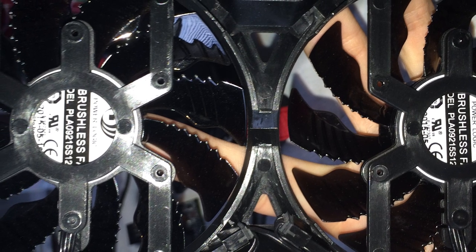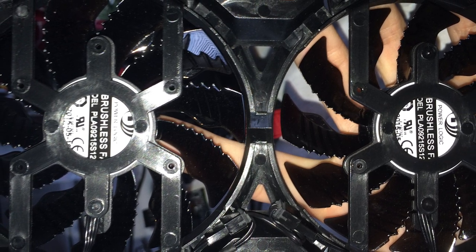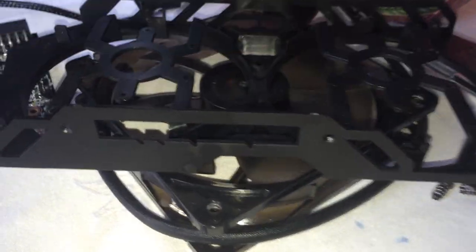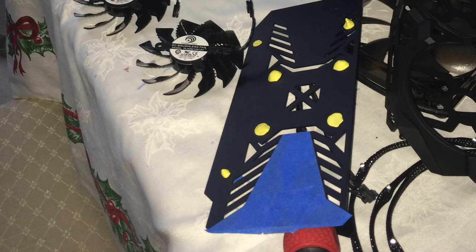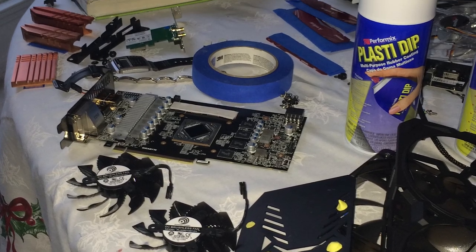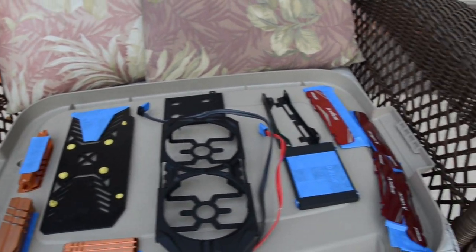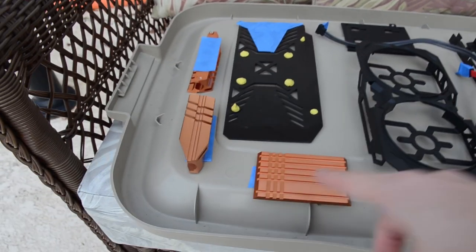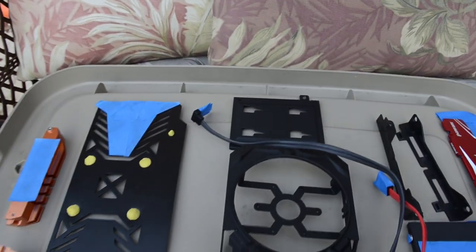Disconnect the heatsink from the top of the card and take a picture of what's left — you'll need this during the rewiring phase of reassembly. Apparently this card only assembles if the fan and LED cables are arranged a specific way. We pulled out the Windforce LED panel and realized it was just an intricate piece of plastic, meaning we could paint this entire thing. We paused and realized just how far we'd come — pretty much everything we wanted to paint was ready.